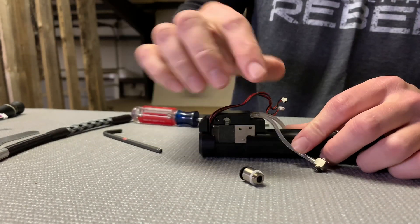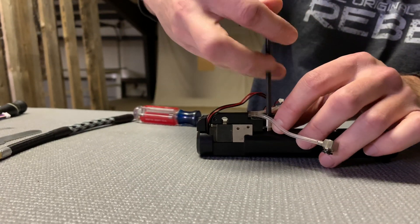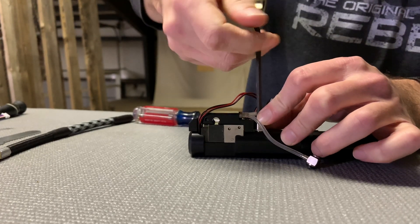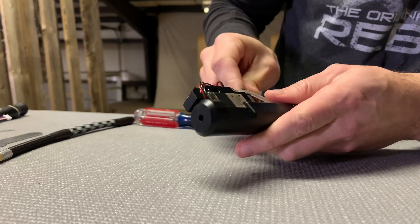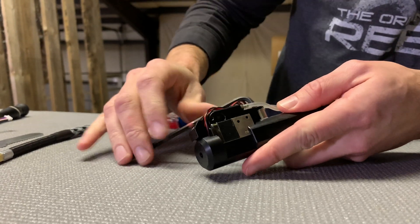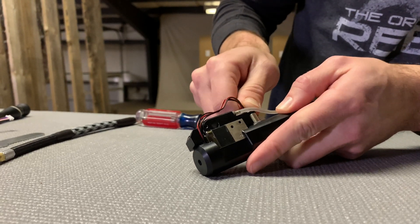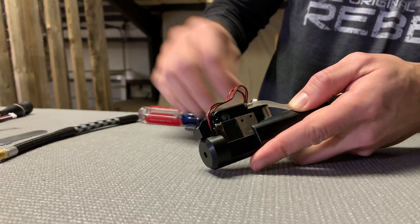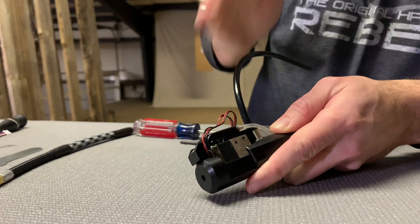So if you're just replacing this fitting, you basically reverse the process putting it back in. This should be torqued to about 30 foot-pounds. If you don't have a torque wrench, go until the crush washer looks kind of opaque — it's spotting out to the surface. You can see it kind of changes color a little bit like that — that's what you're looking for. Just stick the airline back in, give it a tug, and it's locked in place.